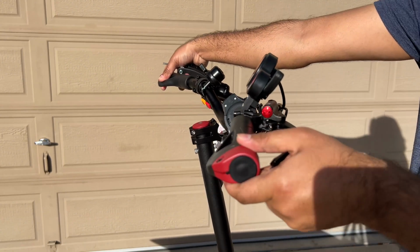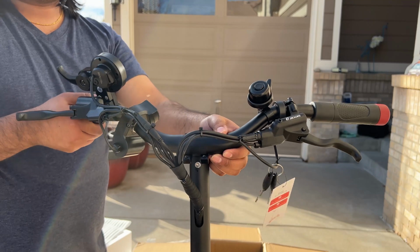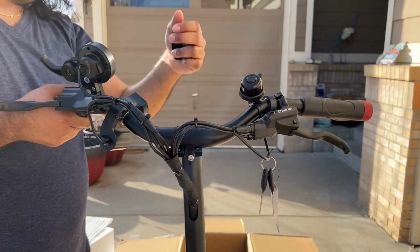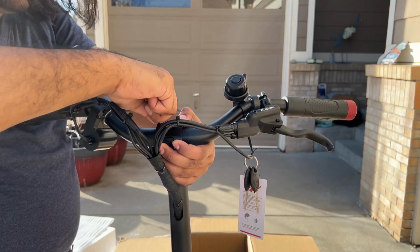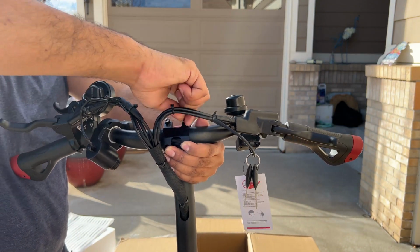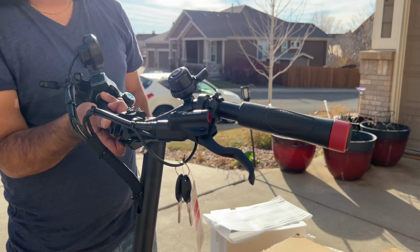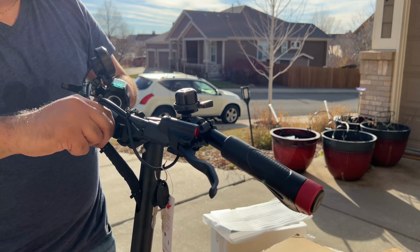Next, place the handlebar with the groove area in the very middle from where we removed the top plate. You don't have to fix the handlebar location yet, as we'll have an opportunity to adjust before tightening the top plate. Now place the top plate we removed earlier on the top of the handlebar and start hand threading those 4 screws. You can use the Allen key that came with the packaging to further secure those bolts, but not all the way through because we'll still need to adjust the handlebar position.